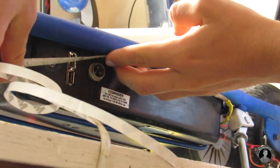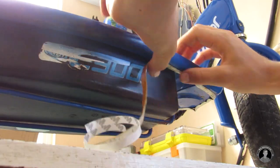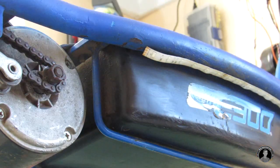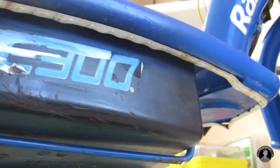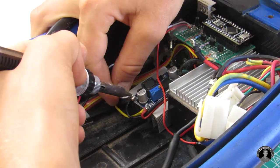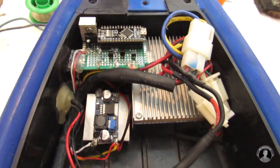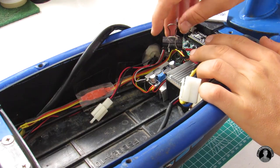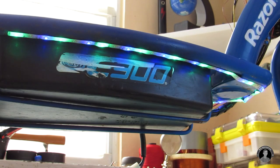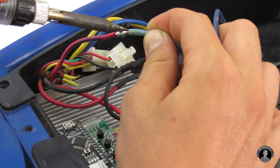With the 3M adhesive backside to these RGB LEDs, it was pretty easy mounting them onto the bottom of the scooter. The last thing for the RGB circuit are the power supply input wires which connect up to the step down converter. Seeing the result of these LEDs shining is pretty mesmerizing. Here I'll extend the two power wires which connect up to the main switch.